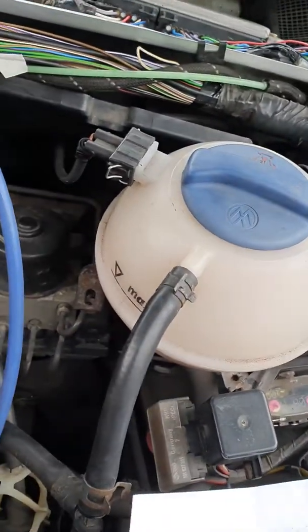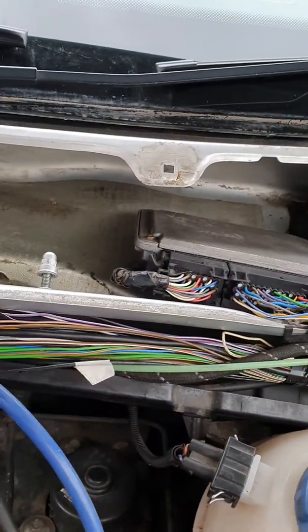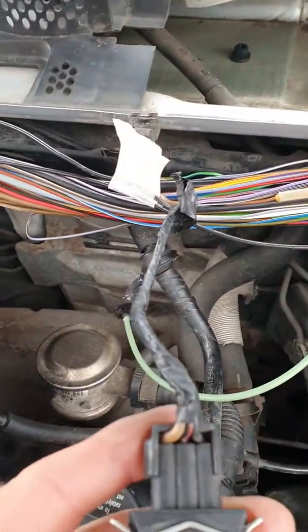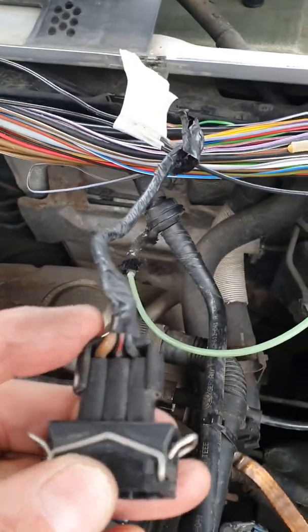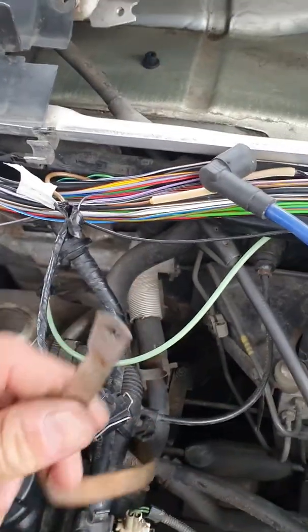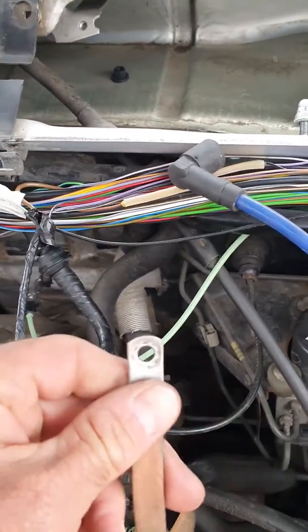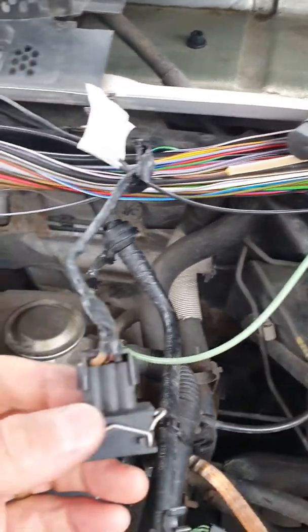To clear up a few things, because it's really hard to work out the wiring, I've taken the loom apart so I could really understand where stuff went. With the HT connector you've got three connections. Your brown is your earth - you need to check that's good. This earth strap had quite high resistance through the contacts, so I've had to polish and clean all that up to get it down to pretty much zero ohms.